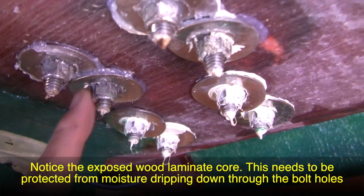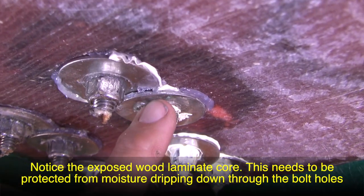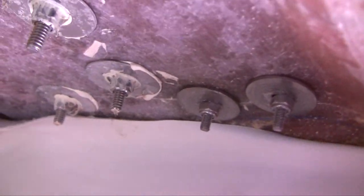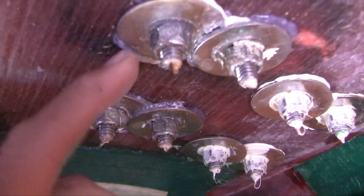With the headliner over there and the light underneath, up here we've got all of our mounting bolts for the two double clutches. The ones we're after are these four. You can see I've got a slightly different sealant than the factory white sealant. These are the mounting bolts for the winch — we're not going to do anything with those. The four clutch bolts are 13mm.